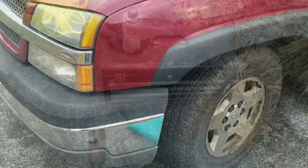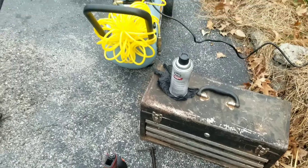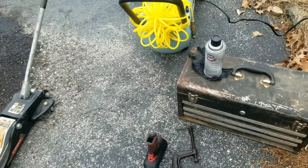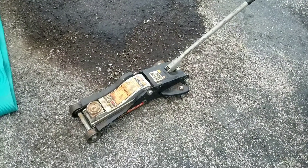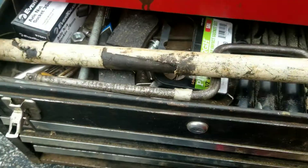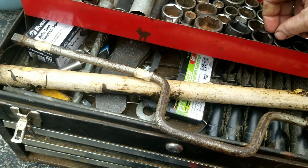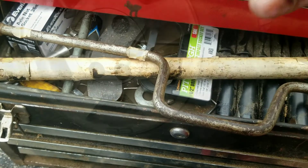Call me a redneck if you will — I'm going to do this right here in the driveway. You're going to need a few basic tools; I'll put a list in the description box. If you have an air compressor and impact gun, use them because it'll make your life so much easier. If not, you can use the tire tool that comes with your vehicle and the jack. I'll be using a hydraulic jack — use one if you've got it to save your back. You'll also want a speed wrench and a 7/8 socket.